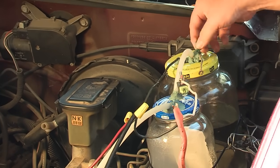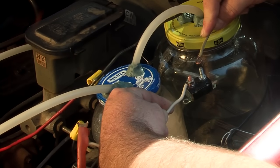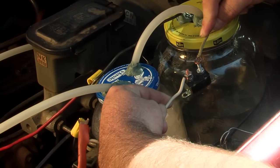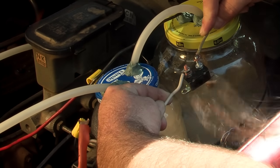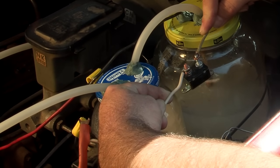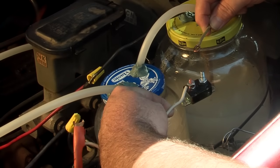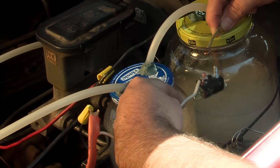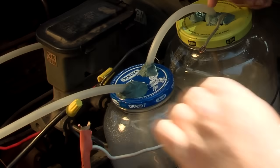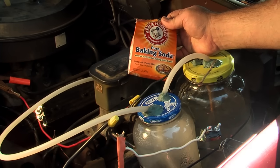It's a little tacky at times, but when it gets hot it will really seal well. This shows you some of the production in the vacuum state — that's a lot of hydrogen-oxygen gas; it's enough to actually cool the water. There's 25 amps flowing through there and we want to run it as close to 30 amps as possible. You can see a tremendous amount of gas — it will actually produce even more hydrogen and oxygen gas as the engine gets going and the RPMs are high.